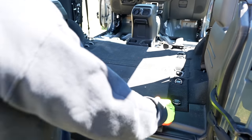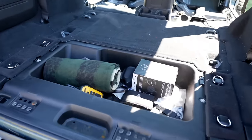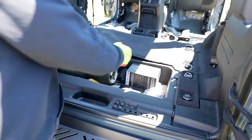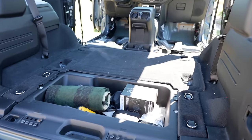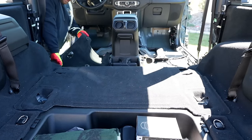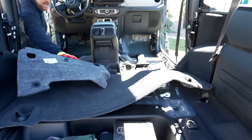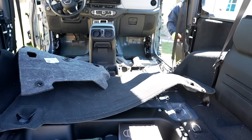Once you get that front removed, we're going to pull our little cargo cover over. Check out what Ryan has hiding in there. We do need to reinstall just this little cargo cover. Look - even your bolts here are rusty, and you got some water and rust in there, because this Jeep gets left out in the rain. So this rear carpet you have to pull off first, and we're just going to work it from the front and pull it all as one piece back. Pop a pin here and get that side kind of pulled off. Let's get all your foam out of here.